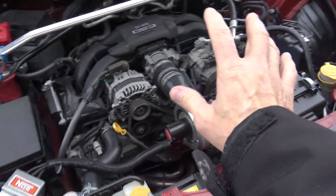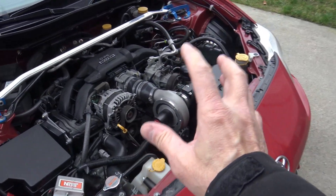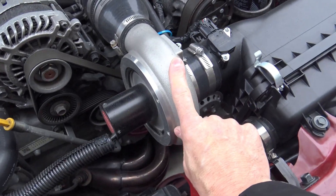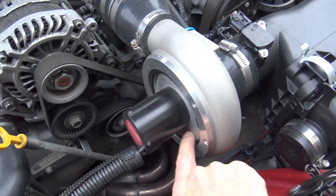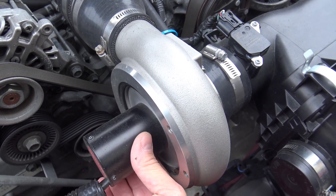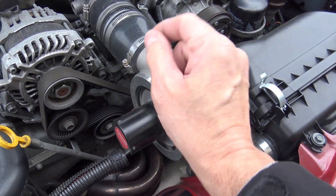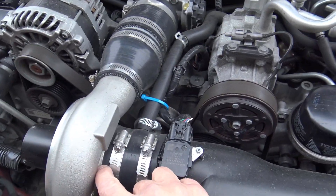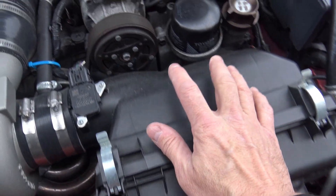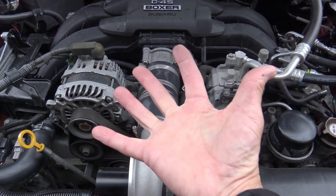But first, a quick overview of my car in case you haven't seen some of my earlier videos — I'll put links below to some of the ones that explain in more detail what I have here. Basically what I've got is an electric supercharger, plumbed directly into the intake. This is the cold side of a regular turbo; the hot side's been taken off. A plate has been machined here to attach a hobby motor — this is a brushless, very high performance radio controlled helicopter motor. This motor spins at 55,000 RPM, which spins the impeller inside here enough to produce up to five psi of boost. Air comes in the regular way, goes into the cold side of the turbo, and is then compressed, producing five psi of boost.